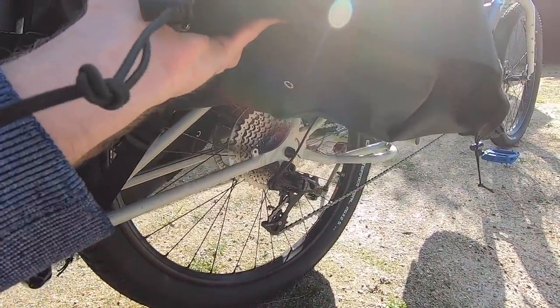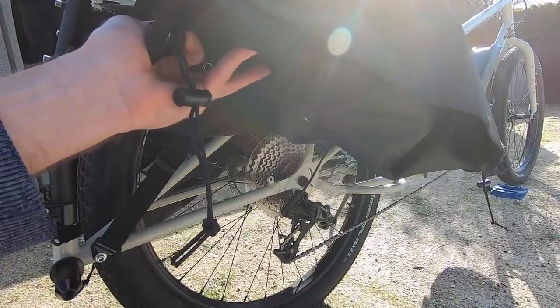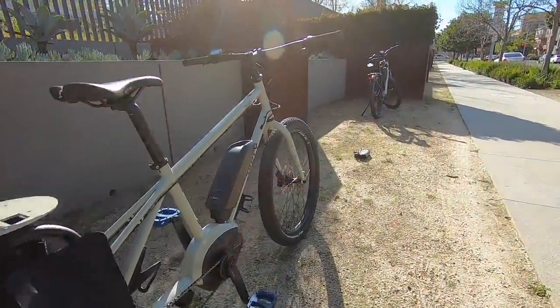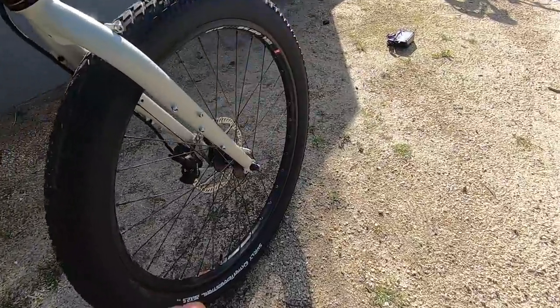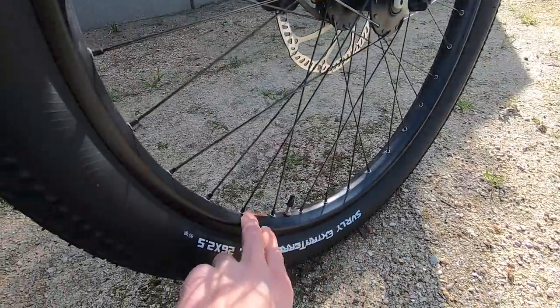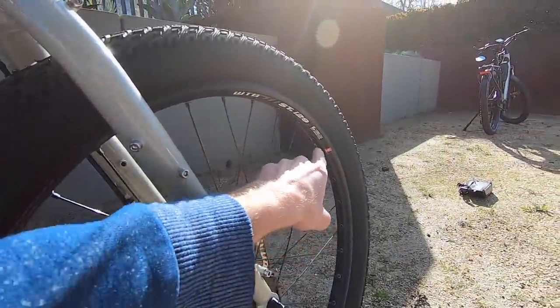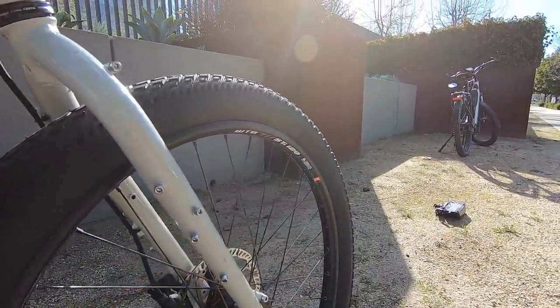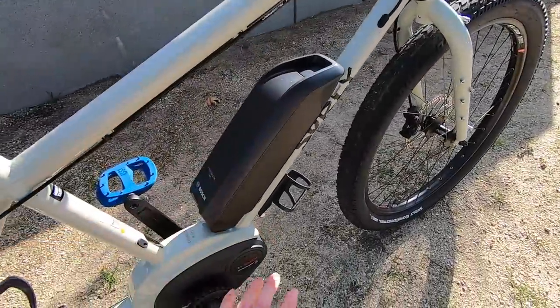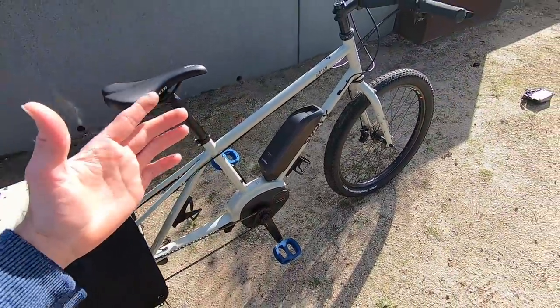The website's decent, but I've gone through and added as much detail as I could back at the full review. We're using standard 135-millimeter hub spacing in the rear with a 9-millimeter axle, quick release skewer — quick release on the rear, quick release upfront for doing some trail maintenance. I love the rims: 32-hole, 14-gauge spokes, black with black nipples, and nice little reinforcement eyelets. That adds a lot of strength, and this is WTB — not generic stuff. You pay a little bit more for some of these name-brand bikes with a name-brand drive system. This is about $5,000.